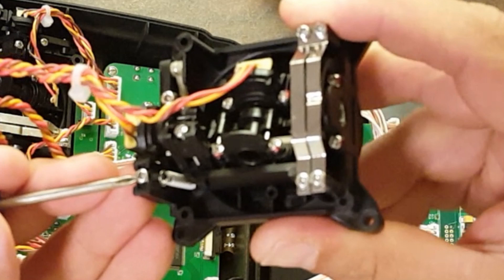I want to call your attention to this screw, which adjusts the spring tension on the up-down axis of this gimbal. Screwing it in makes the spring tension tighter, and screwing it out makes it looser. Since we've disengaged the centering on this gimbal because it's the throttle gimbal, this isn't going to do anything here. But on the other gimbal where you have centering on both axes, you could use this to tighten or loosen the feel of the stick. Unless you have prior experience that leads you to want a looser or stiffer stick, I'd suggest just leaving it alone.